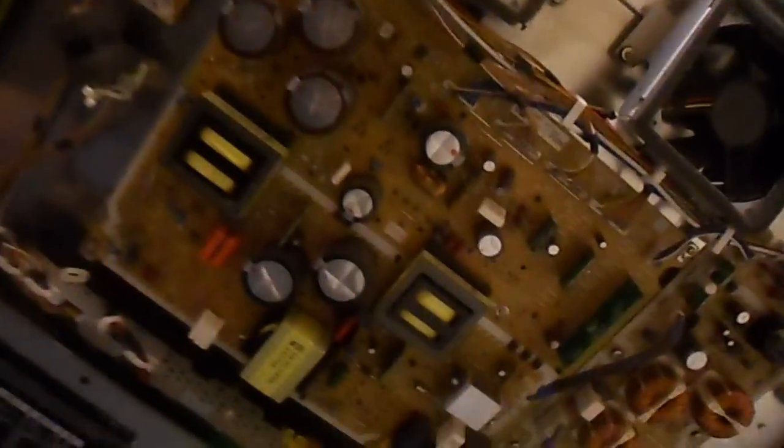Board purely, whose purpose is to split the fan connectors out. Power supply board, which is massive. Now, interesting thing about this power supply board, you'll notice there's no heat sinks except that one there on the top, and it turns out actually all the transistors for the heat sinks are mounted to a metal plate. So it acts as an excellent heatsink, and that's why I've got two fans there to pull air through that.